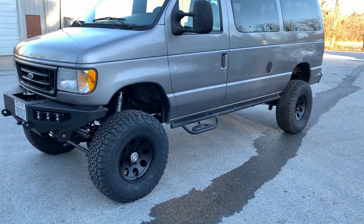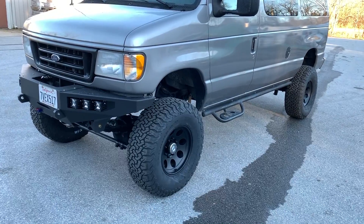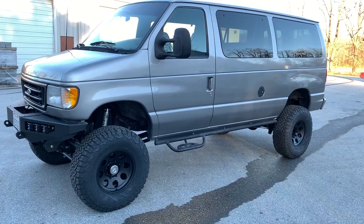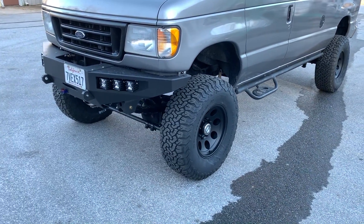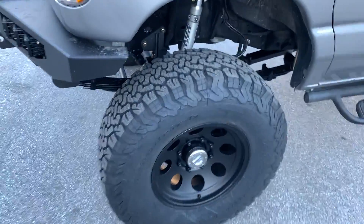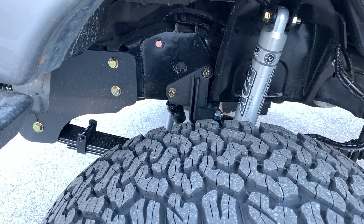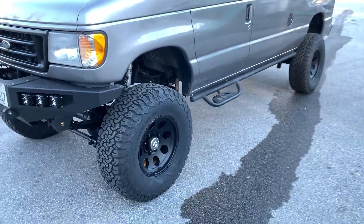The radius arm brackets, just like the ones we've seen in the past, are just welded on with a few inches of weld. The bolts really aren't doing anything because they torched the holes out with a torch — they're not to fit, they just look like they're working. The upper track bar mount — they've made efforts to beef those up by adding a lot more material. You can see the remnants where they plated the frame up there. I still think it'll fail, but this one did not.